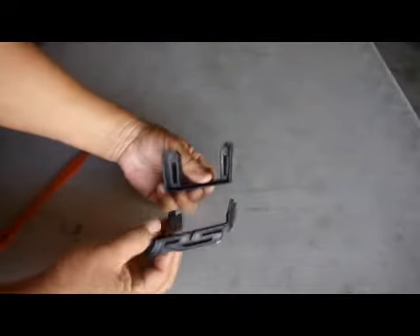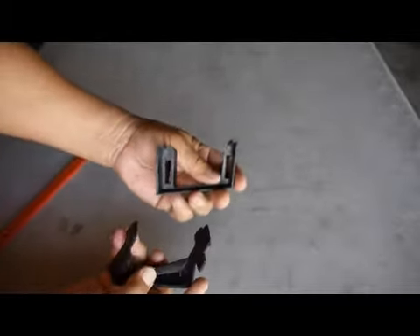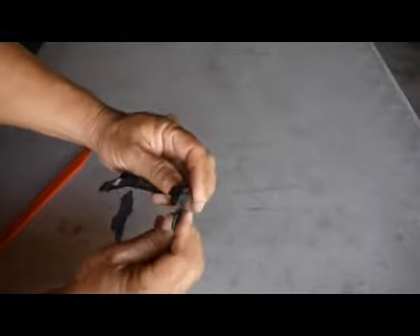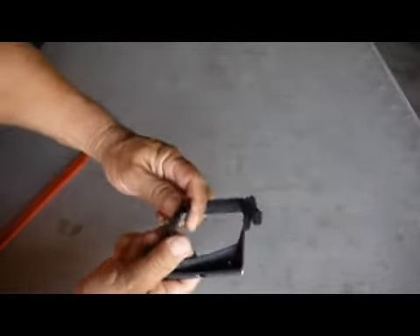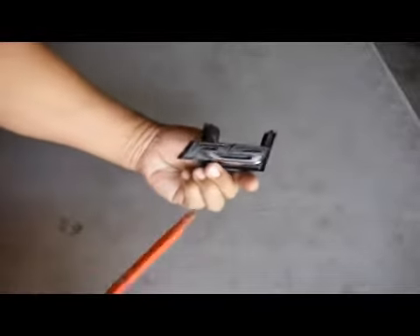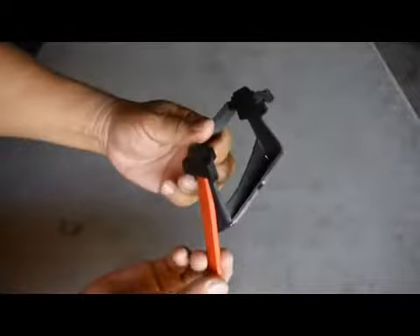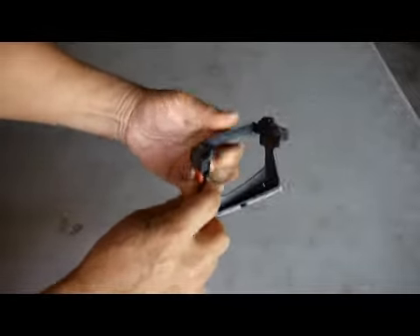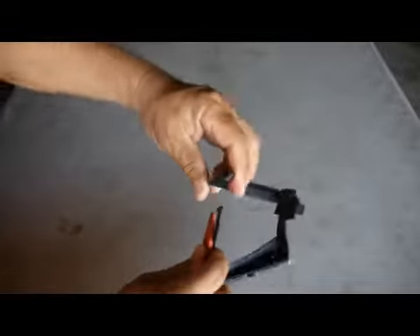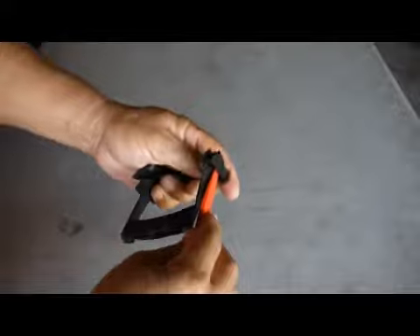Here are the two pieces out of the car. These are the clips, here's the backing, and this is how they attach the clip. So what you're doing with your tool when you're going in from the side is you press it in so you can unclip it and then you're pulling from the front. That'll release it, and the same thing when you go in on this side.